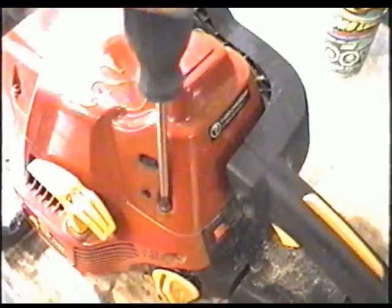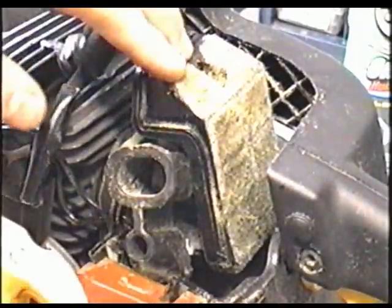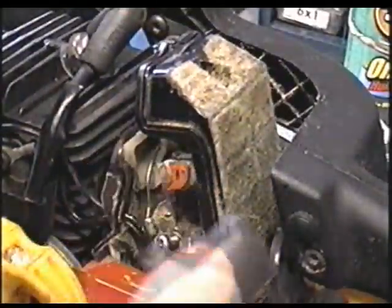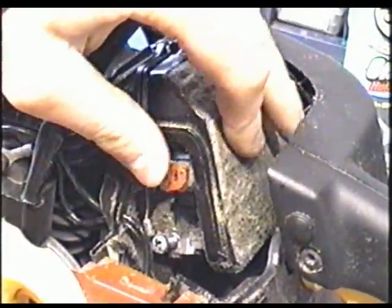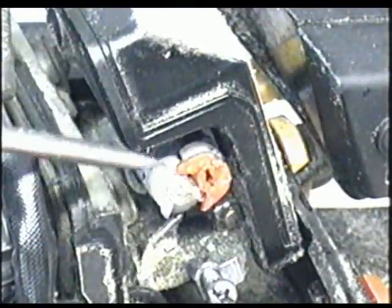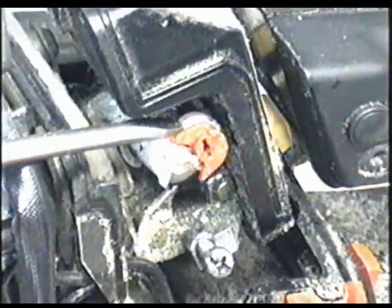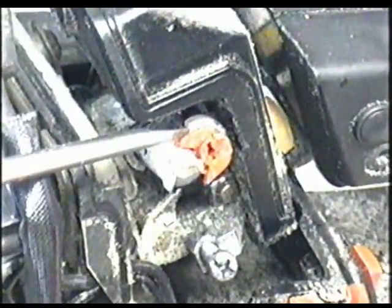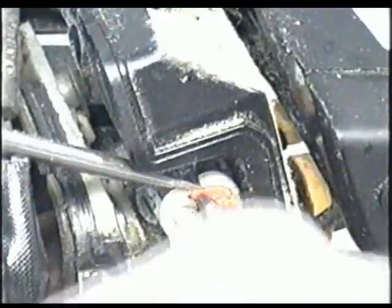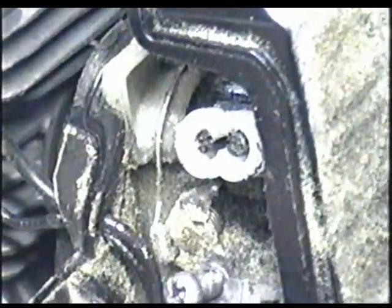First I'm going to take off this cover. Now once you get the cover off, you want to remove this boot here. And here are the screws — there's plastic covers on them. To remove these plastic covers, you have to go in and spread the clip here, the white clip. What this will do is allow you to pull out the screw cover. There's one. There we go.